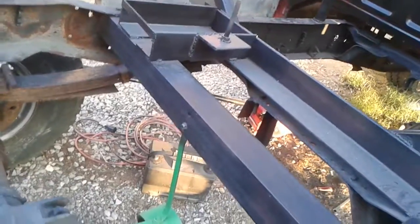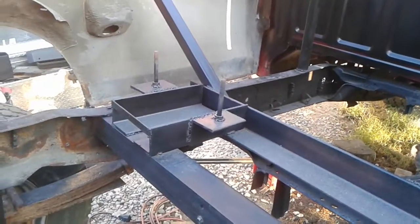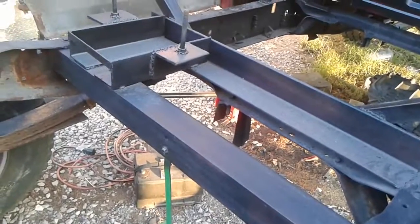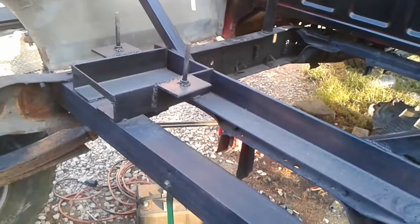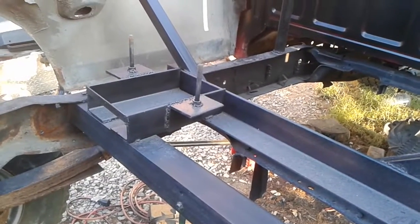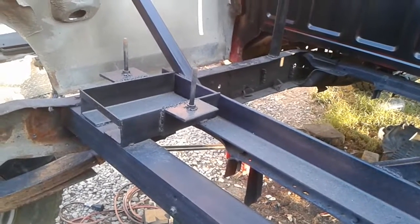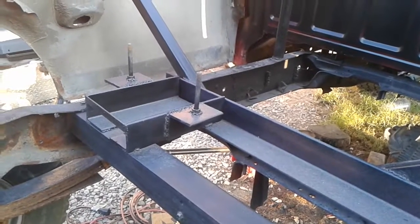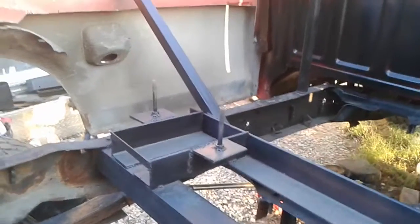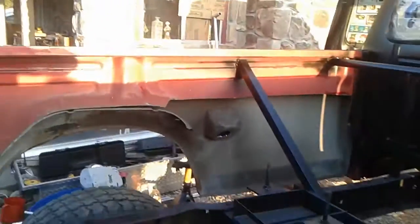Besides the driveline collar support sitting in it, the angle iron also holds the battery tray, and my fuel cell will be mounted back here as of now. That plan may change, but as far as it goes right now, the battery is going to stay in the back of the truck. It just keeps everything out of the way up front. We're going to run a battery shutoff switch through the original gas neck in the truck here on this bed side, as you can see.